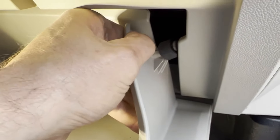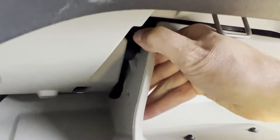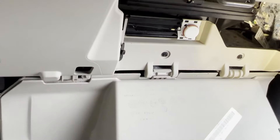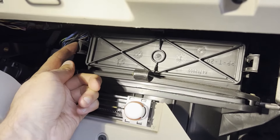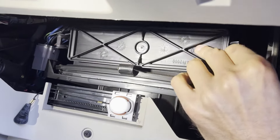As I mentioned, these sides squeeze in — they're flexible, which is why there's a slit at the top part. You can squeeze those in a bit further. Squeeze the one on the right, then squeeze the one on the left, and the glove box should just fall down and out of place. That's going to reveal the cover that covers up where our cabin air filter is. There's a clip on either side of this cover, and you should just be able to squeeze inward on each clip and that cover should pop off.